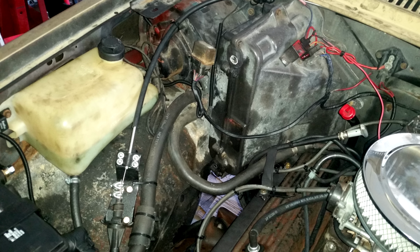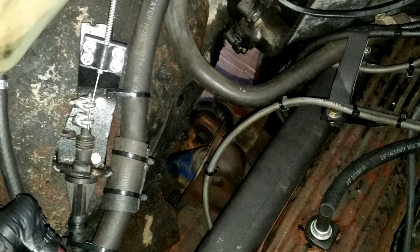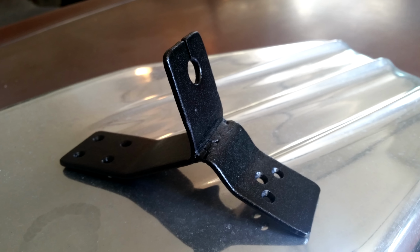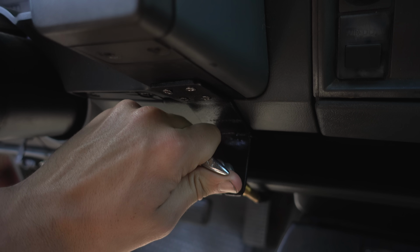Another thing that needs fixing is the four-wheel drive. On these trucks, the vacuum actuator that connects the front differential to the drive axles inevitably fails. Instead of just replacing it, I'm using a locking cable from Napa and a guide I found online to very cheaply turn that into a manual front axle.